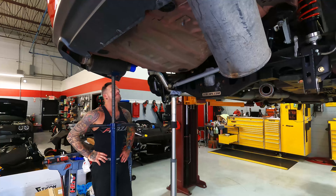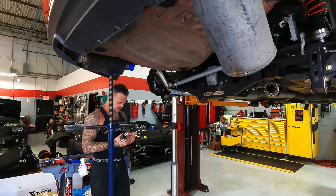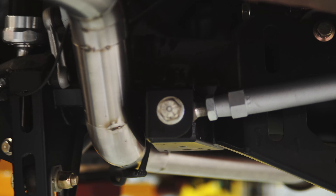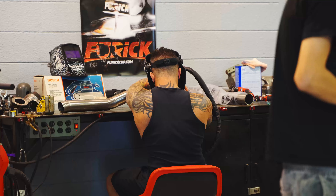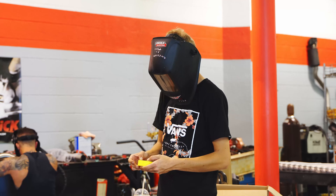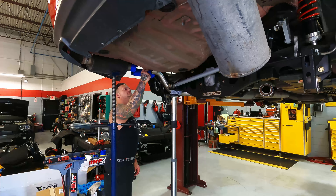What I'm doing right now is, when you do the four-link and take out the stock subframe, you can no longer use the same exhaust. You can use the front section and the back section, but you've got to make intermediate pipes. So I'm fabricating two connection pipes to go from the front to the back that will work with the four-link. I'm going to duplicate those several times because we've probably got three or four cars getting this four-link. Now that I've got a design I like, I'm just going to replicate it. Once we're getting together, I'll show you all the process, the end product, start it up, and you can hear what it sounds like.